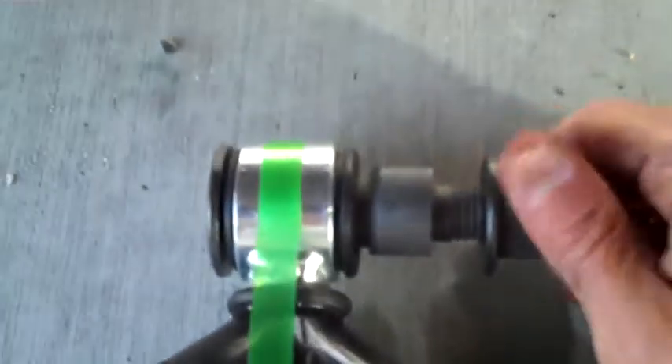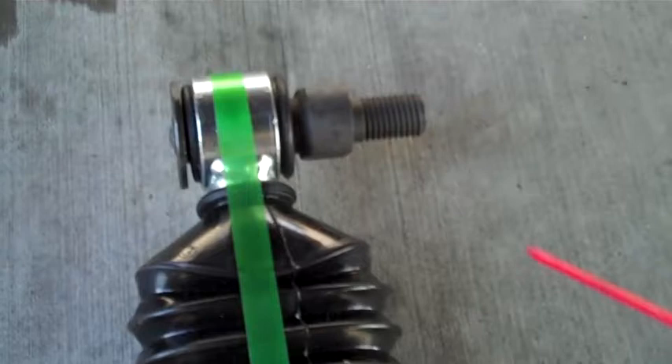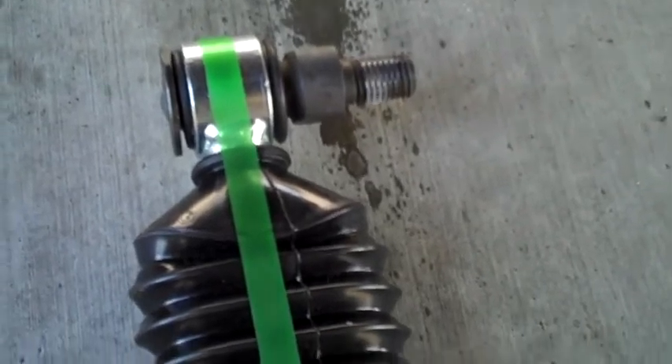To get the top bolt out on the back side of that pin, you have to get yourself in between the rear differential, the gas tank, and the exhaust pipe to get that nut off. Once the shock is off, you can see the hole in the frame where the upper pin goes has a little bit of rust. Clean that up — it's a lot easier to clean and paint while the shock is off. I just sprayed a little flat black; it's going to look nice under there. For the new shocks, they come with an upper pin already in place. Spray the bolt on the back side with a little anti-seize first, then put the upper part of the shock into position first.